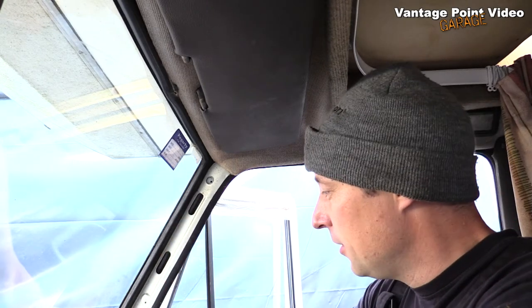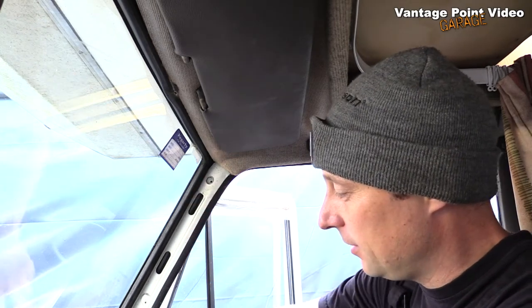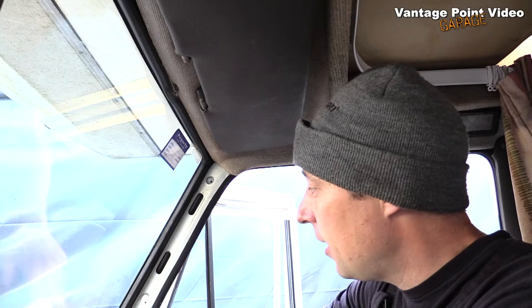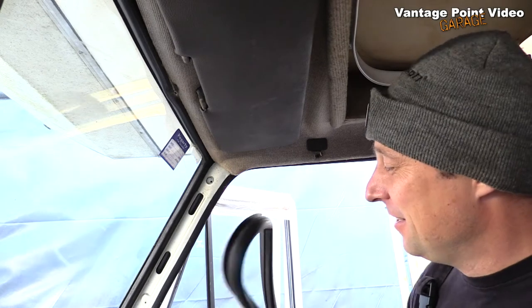I cracked a Cadet windscreen doing this a number of years ago, so I started cutting those out and just using up the spare rubber surrounds. So luckily, when I got my first Talbot Express, it needed quite considerable welding repairs. It needed most of these A-pillars rebuilt, and the seller provided a brand new windscreen rubber with that. But there was actually nothing wrong with the old one, and because that one was so rusty, I just pushed the glass out of that one. So at least in this case, I was able to save the rubber, and so I've done myself a favour from about 15 years ago, and I have that now.